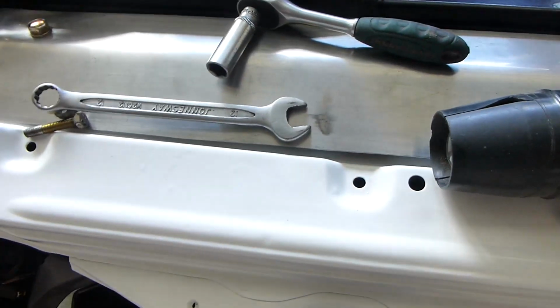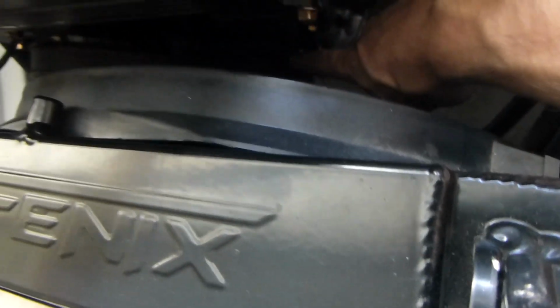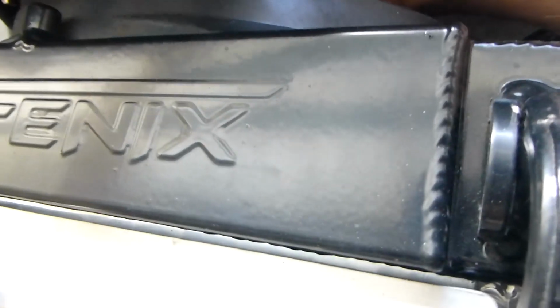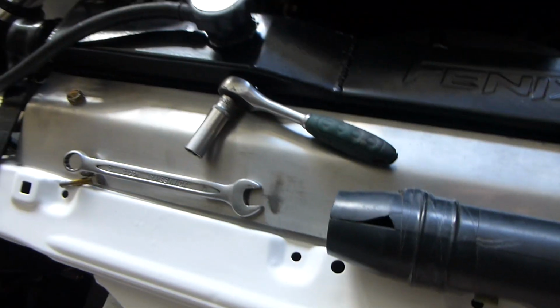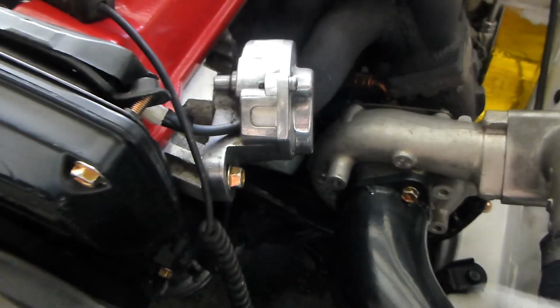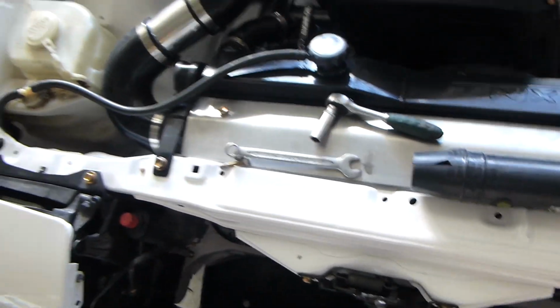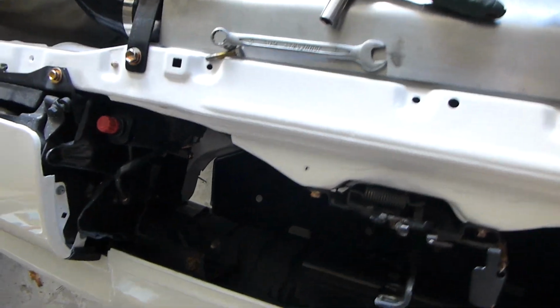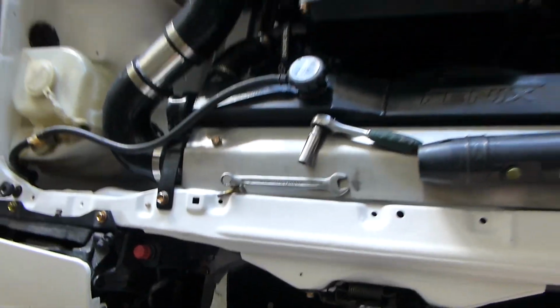Because this thing's rattly on the way up, I couldn't really show you what I was doing, but down on the pulley there's a mark that matches up to numbers on the case, and you basically shine that light, hold the button down, and it blinks at what timing it's set at, and I just move the distributor or cam angle sensor to suit to bring it back to 10. But because this is on the way out, you basically have to just slap the side of it, but it still works, still gets what we want.